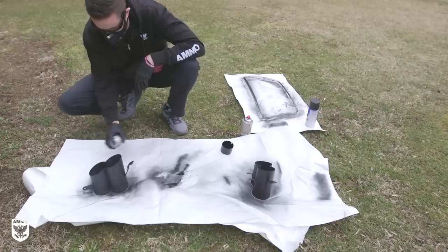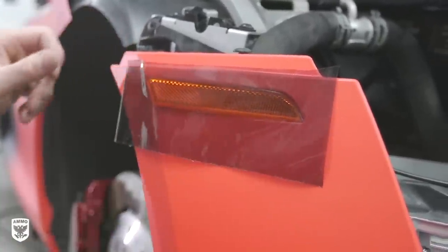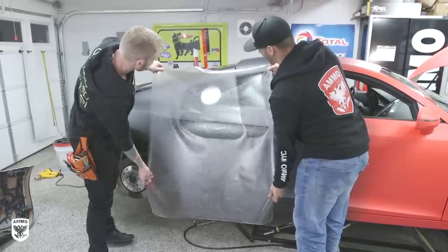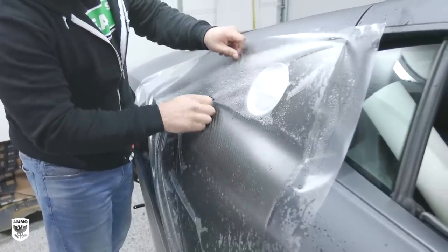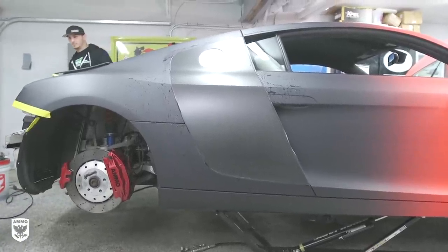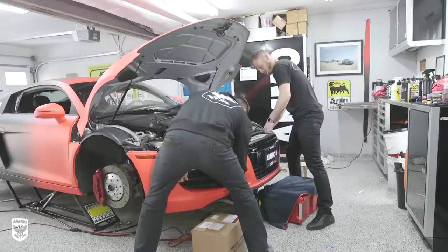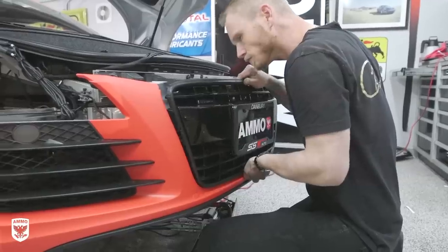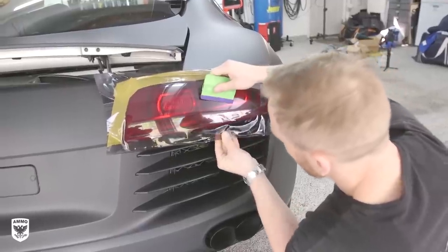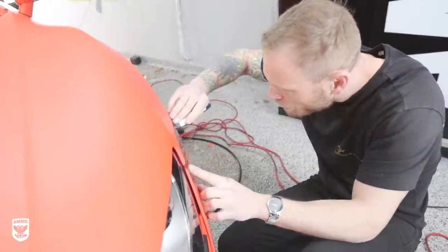While Tom and Christian worked on the front bumper, I plasti-dipped the front chrome grille and repainted the exhaust tips with high-temp paint. Once done with the hood, we installed a light tint on the turn signals to match the new wrap and removed the old half bra on the side blade. Since the blade was gloss while the rest of the car was matte, we reinstalled a full clear bra in matte finish to match. The next day we reinstalled the taillights, secured the rear bumper, repeated the same process for the front bumper, and mounted the freshly painted grille, securing the bumper with an endless amount of screws. Then I mounted the wheels.